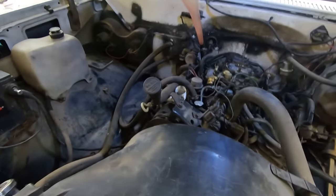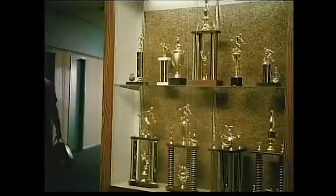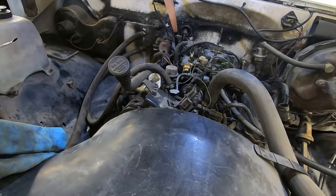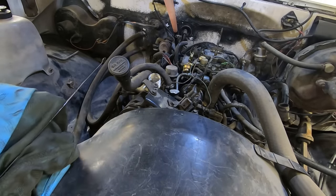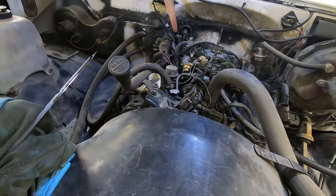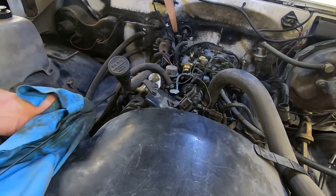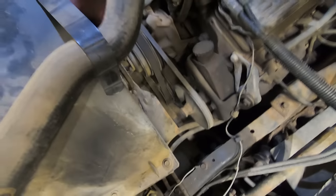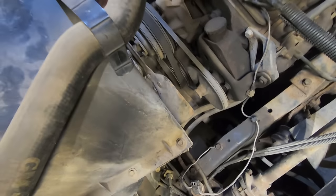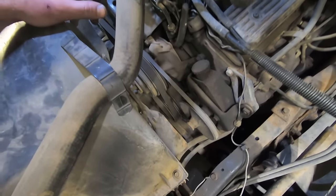I didn't check the engine oil. Check the dipstick. She's way up there, like she's been getting too much fuel, so we should maybe address that. And she's way above full. Looks pretty clear too. And smells a lot like gasoline. Oh, radiator's full. Well, that kind of sucks. Stupid water pump. That won't be too hard to change though.